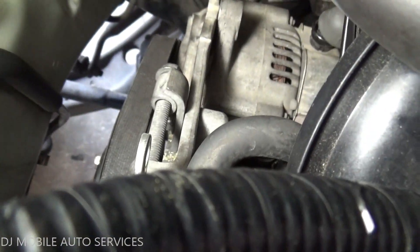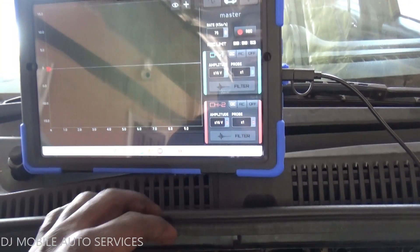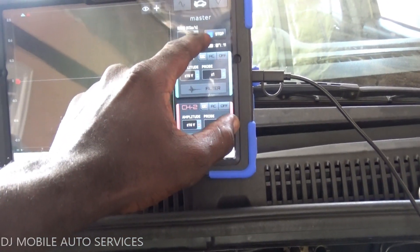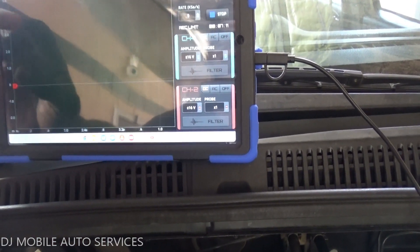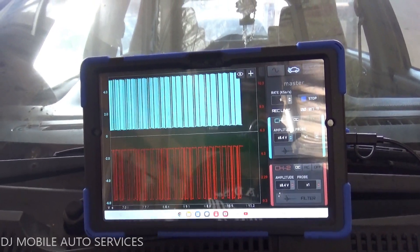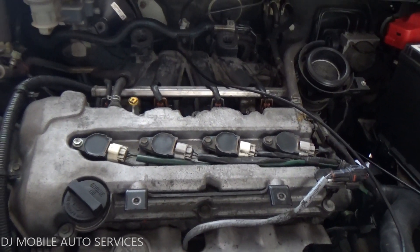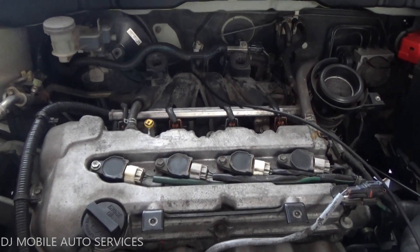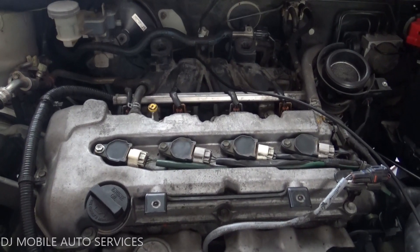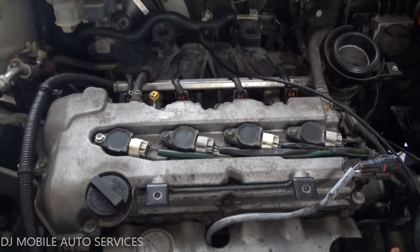That means the ECU is working and the harness is good — so it has to be this engine. I'm putting my lunch money on it, that's how sure I am. I've got my two-channel scope hooked up — an HSOS502 — and I'm getting a capture to compare to a known good. The blue channel is the crank and the red is the cam. My recommendation to the client is to replace this engine and put in the correct four coil pack engine. Like, subscribe, share, and leave comments on how I can improve.